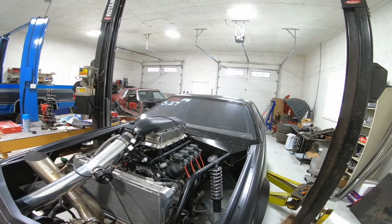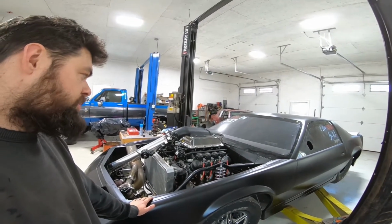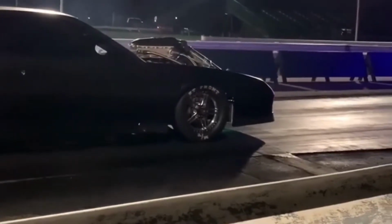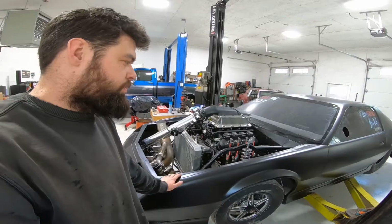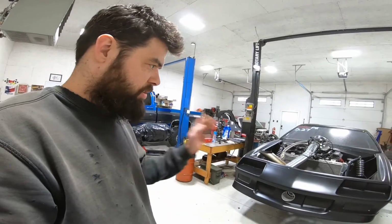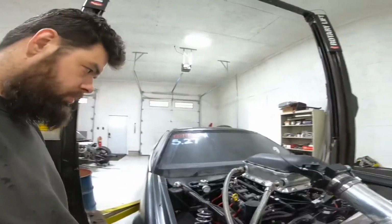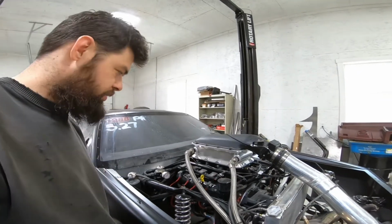And he ran it, I think, last season was short because of the pandemic, but I think he ran it for at least 3 months, just about every Friday. And the car just runs consistent 520 at like 133, 135. It's on 33 pounds of boost. It seemed like anything over 28, it wasn't picking up, so I set it like that, but on a cold night you will see low 30s, just because of that denser air. It runs good, it still starts right up, and I don't know what the condition of the stock rods are or anything, but it's on C16.